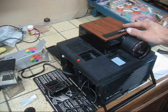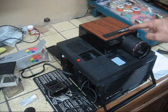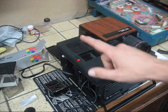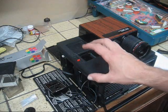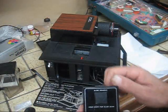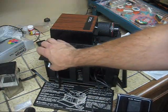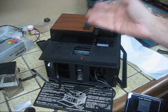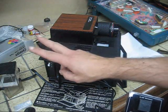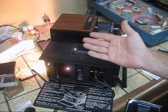There are a couple sub-models of these, but they all use the same cubes. This one happens to be an RC-55, but a number of them are very similar. They function pretty similar and have the same critical parts. We're going to do a little troubleshooting here, try to figure out what's wrong with it first. First off, plug it in. The first selection is for fan — turn it on, make sure your fan is working. The fan is working. The second selection is your lamp, and the lamp is functioning.